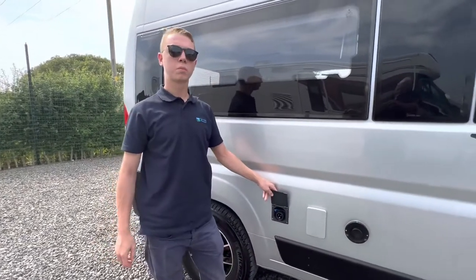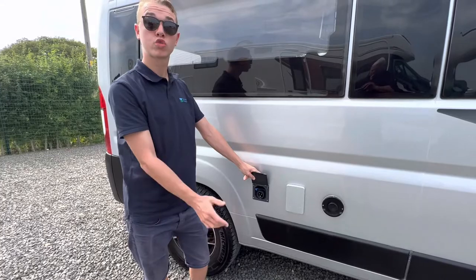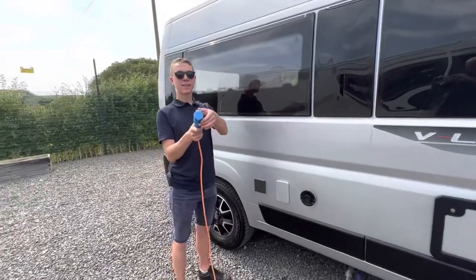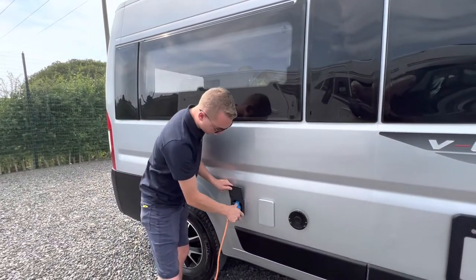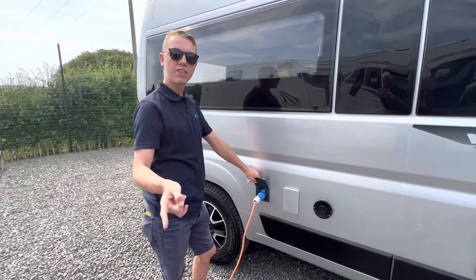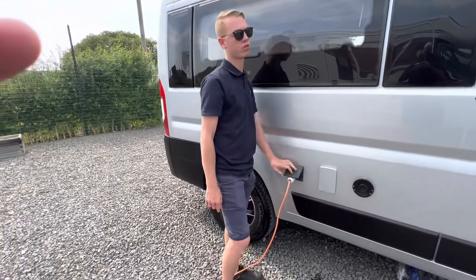This is your hook-up point, where you connect the vehicle to 230 volts if you're hooked up on a site or charging at home. Get your hook-up lead, lift the collar, lift the flap on the van, and slide the coupling on. Hook the van up first, then the power source. Do it in reverse order when unhooking, along with pressing the blue clip in the left-hand corner to release the pins in the hook-up lead.